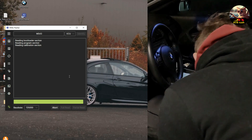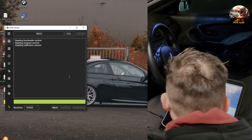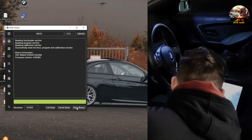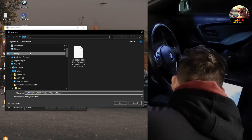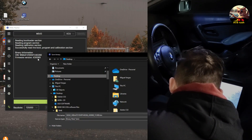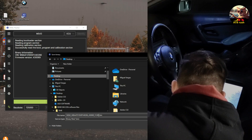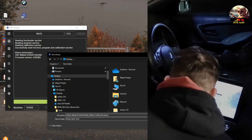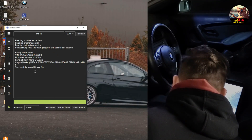Now it's about to finish — it's already in the calibration section. This is a full reading of the ECU. Now that you have your full reading you'll want to save the file, and here we go with 'Save Binary.' One important thing here is to check that the firmware is 0069, because that's very important later when we process this file. I'll call this one 'subdelete' because I have the subdelete in this vehicle, and save the file.